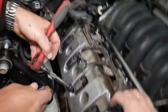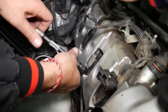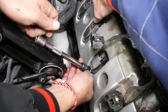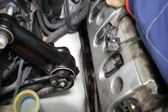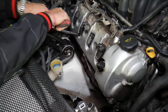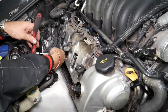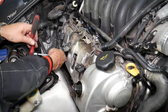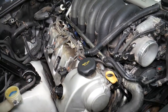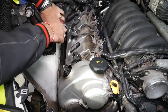Now we're going to remove the ignition coils — get the bolts loose with E12. At the same time, disconnect the wires. Let's go ahead and do that to all coils. These coils will be stuck really bad. This is also a good time to check your coils and replace spark plugs — we'll put the link in the description for the four-prong (multi-ground) spark plugs we used on the other side.